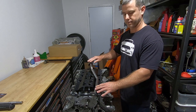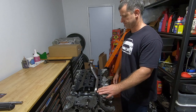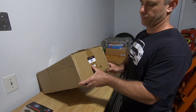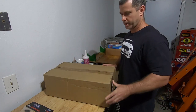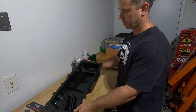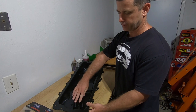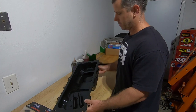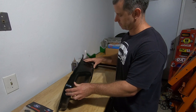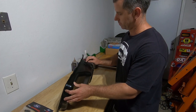I'm going to get the oil pan on here and check it before I start carving into this gasket. For the pan I'm using this Ultra Power part number 264463 pan. Looking at it, it's a pretty good factory style pan. You may need to cut the scrapers off of here. It also has provisions for the older 4.6s that had a low oil level sensor.